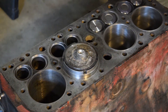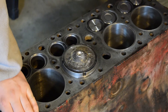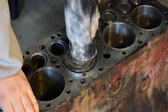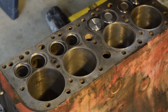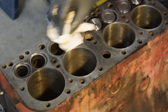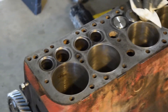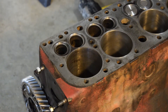We're not hitting very hard, but it's driving the sleeve right in. You can tell right when it bottoms out. Pull this out and everything's perfect. You want them to be flush with the top of the engine block — and that's exactly what we are. So we have one more sleeve. We're going to pull that out of the freezer and drive that bad boy in. We'll bring you back once all the sleeves are in. Still waiting for those valve guide seals in the mail — we bought them for ten bucks for eight of them.